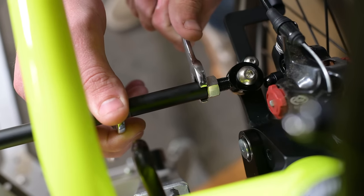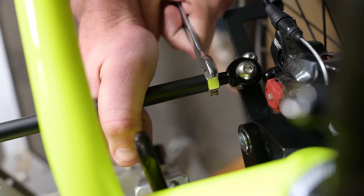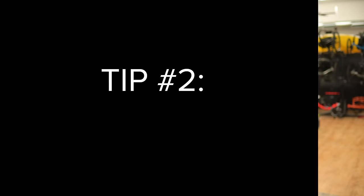Before you adjust or check your alignment, we recommend that you make sure the steering spindles do not have any slop in them, as well as checking the tie rod ends, making sure that they are tight. If you have a trike with suspension, it's always good to set the alignment with the rider weight loaded, as the alignment may change slightly as suspension moves down and up.